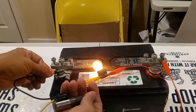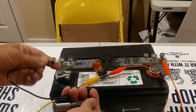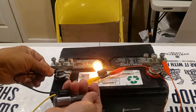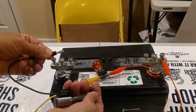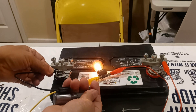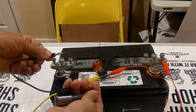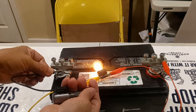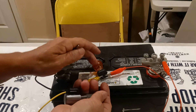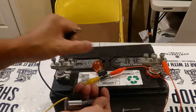Do you hear that big click once I took off the wire from the negative? It also clicks when I connect it, but not as strong as when I disconnect it. There we go — so this shift solenoid has passed its test. If the bulb would not turn on, this shift solenoid would be bad. Just make sure you have good wires and the bulb is good before ruling out that the solenoid is bad.